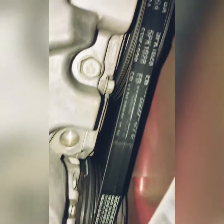Sorry for it being dark guys, I don't have my flashlight on me. Going to be checking for leaks — the starter looks like it has some oil on it. There probably is a valve cover gasket seepage.